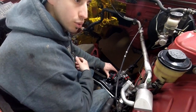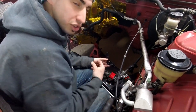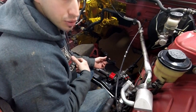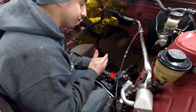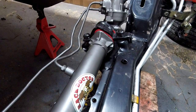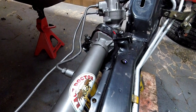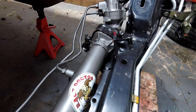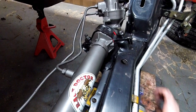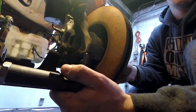I forgot — I'm going to grab my grease gun and grease the polyurethane bushings, inside and out, just a little bit, because I don't want them to start squeaking. Polyurethane is known to squeak, and once I'm driving this thing it is not easy to take out with an engine and trans in here, so I don't want to take that chance. Now back in the wheel well — here's the new outer tie rod. We're just going to do the opposite of what we did before and slide it on.